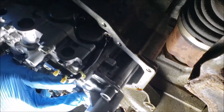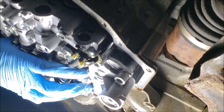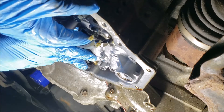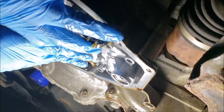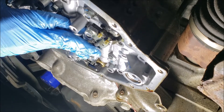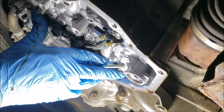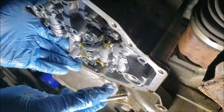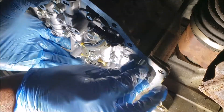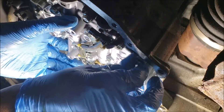This is a conclusion of the fixing of the P2589 on the Nissan. I'm putting back the valve body into the car and also providing alternative solutions. In my case, I soaked the solenoids in carburetor cleaner to break the gunk that had built up in the solenoids, then blew it off to create space in the holes of the solenoids. An alternative is to buy a new valve body and install it on the car.